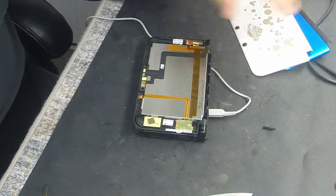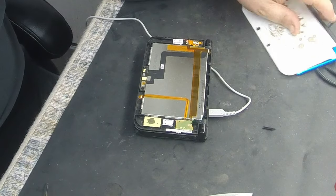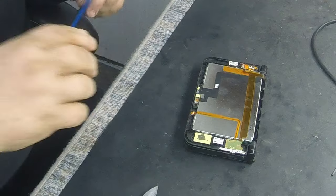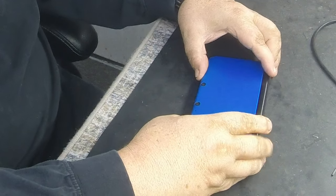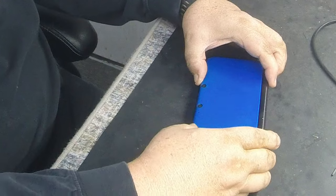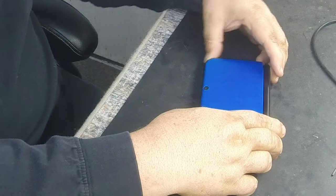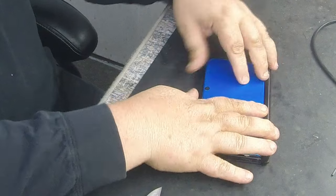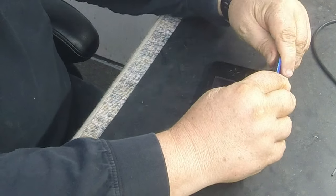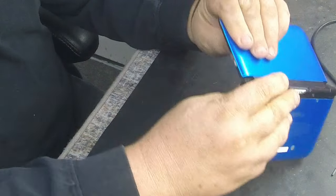That literally is all you have to do to replace that slider. The scariest part is getting the back off. I've got a different color back — I'm going to put a blue back on here. When you snap it back on, I found that if you take it from the front and set the front in first, then kind of slide it forward, it locks in there — it's got like a hook that goes underneath. Get all the front nice and flush, then go ahead and snap the rest of it in. There you go, she's all snapped in.